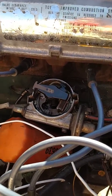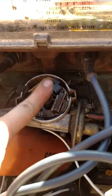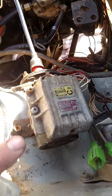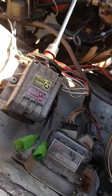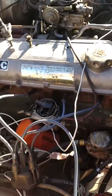This thing originally had points from the factory. We had actually taken a pickup unit and a reluctor wheel top half off of a 20R distributor, and now I have an igniter unit that I think we pulled off of either a 4Runner or something carburetor — I can't remember exactly which. So a few people were asking about it — yes, it does run.